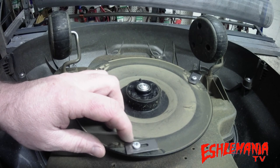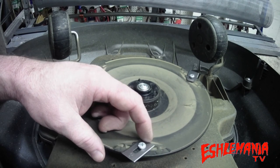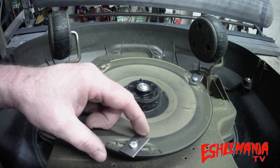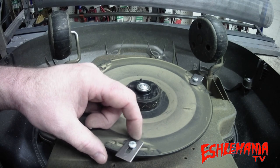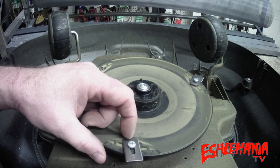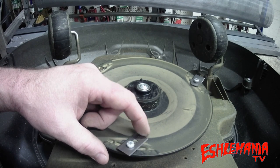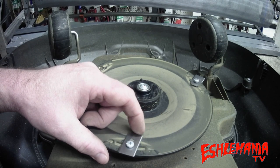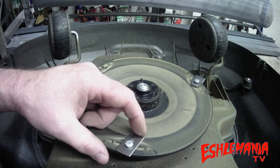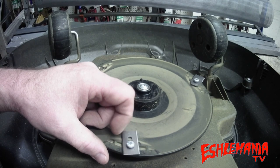Here's how the endurance blades work — same setup as standard blades where hitting a hard object causes the blade to swing back in, with centrifugal force holding it out to cut the grass. But because it has that slot and the cutting edge runs the full length of the blade, it can not only spin around the screw but when the cutting disc starts up it can kick the blade out and actually start cutting with the other end of that blade.